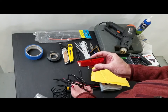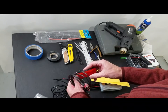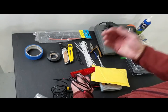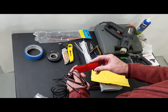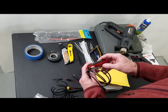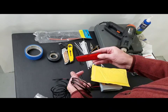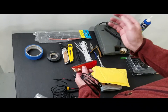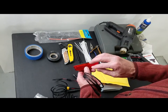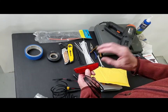It's called the Vike e-bike taillight. What's really nice about that, I'll include a link in the description, works over a wide range of voltages. So the voltage going to the headlamp is only about 5-6 volts. As I tested it, this will work at 6 volts all the way up to 60 volts. Again, I'm not using turn signal things. All I want is some visibility from behind.